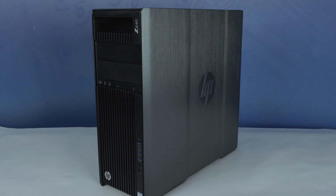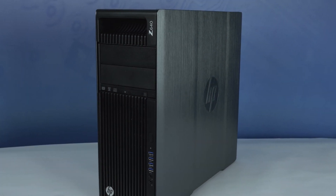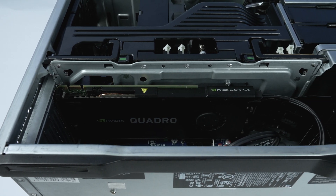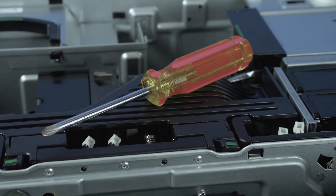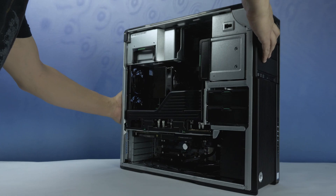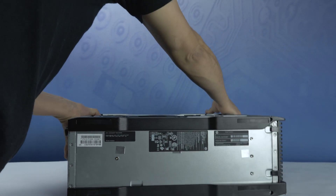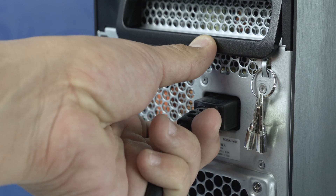Hello and welcome to TechBoost TV. I'm Jaime and today I'm going to show you how to install both powered and non-powered video cards into the HP Z640 workstation. Before beginning, we recommend checking with the manufacturer and ensuring the latest firmware is installed. For this installation you may need a Phillips head screwdriver. We recommend going through this process with the workstation on its side to have better access to the system's interior. Please check out the QuickSpec link in the description below to learn more about video card compatibility for the HP Z640.